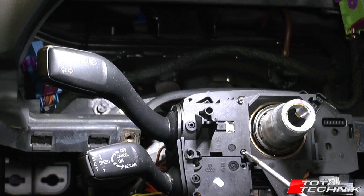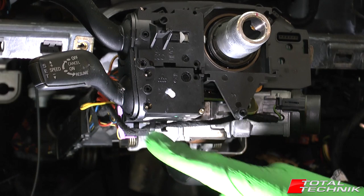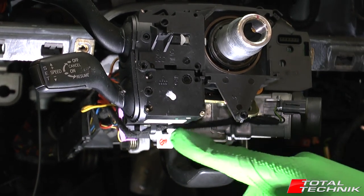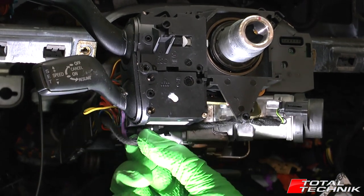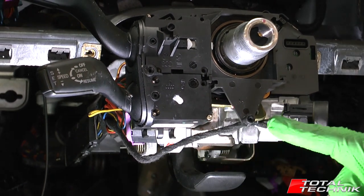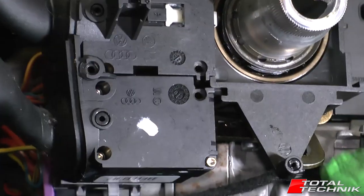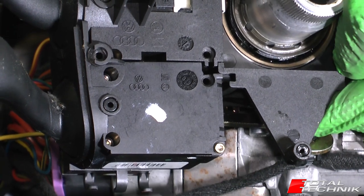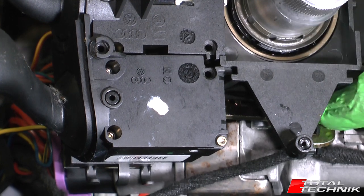First stage: there are more of these little black screws here and here — get both of those removed. Next, if you look underneath, you've got this little cable here for the key chamber electrical supply. Just here you've got a little bracket that it sits in, so just pop that out like so. You'll see that it follows along and goes into this gold metal section just here, which is part of the other section we're going to be removing. Rather than cut the cable tie, I'm just going to push this back through with a flat-head screwdriver.